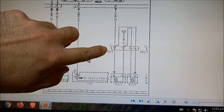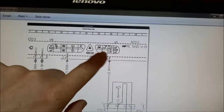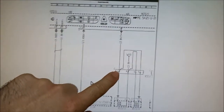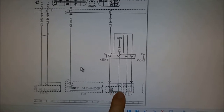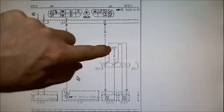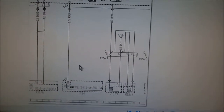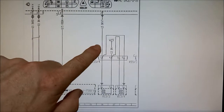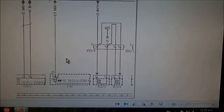The heater elements are not plugged into the seat control unit. They come straight from the dashboard switch — the switch sends power straight to the connection block, it splits, goes over to the other side of the element, connects the two heaters, and then goes to your W19 earth connection, which is bolted to the chassis. So somewhere in here we have a break in the wire, because we know the back heater works, so the ground part of the system is working — it's just the seat part that has a break.